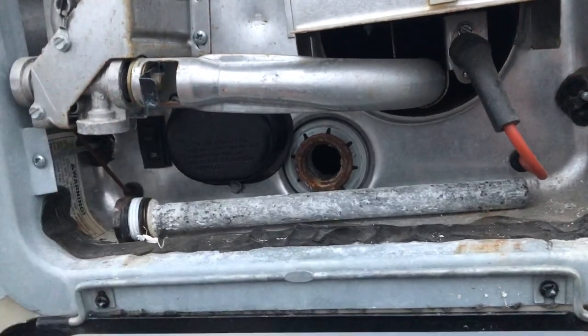One other caveat — there are three things I didn't mention in the ten steps. Number one: the hot water heater. We always take the anode out of the water heater after every trip. Taking it out drains the water heater so we don't have the water going funky in there. That's that part of our winterizing — we take the anode out and let it dry.